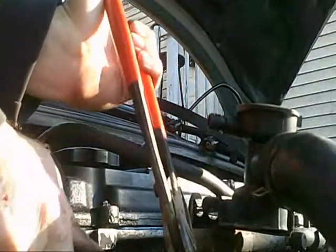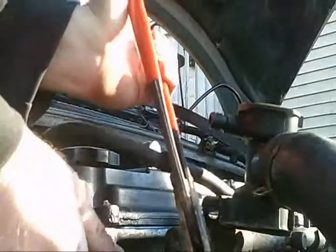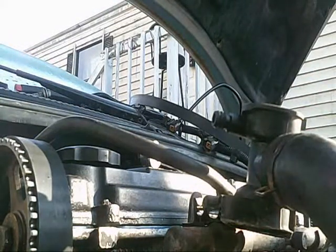And we can move the alternator, so that take the serpentine belt off, get it out of your way, so that it can move along. The belt is removed. Alternator's loose. Now I should be able to pull this back and take this little 10mm wrench. Pop this off. So we can clamp right on there.